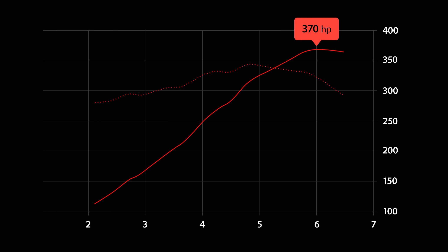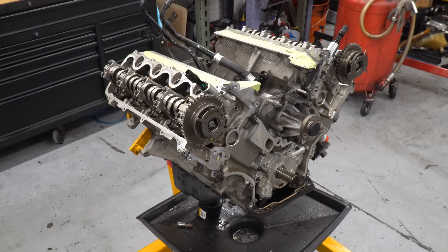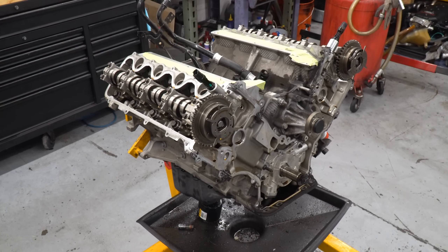So how long did it take, and how much power is the Mustang making? It took my shop roughly three weeks to rebuild the engine, and currently the Mustang is only putting down a paltry 370 wheel horsepower, which is 30 less than I was hoping for at a minimum. I think the lackluster performance is because the cams I have now aren't optimized for a stroker engine or ported heads, so I'm going to install a set of super aggressive high lift cams and see where that gets us. If you're interested in seeing how this plays out, you know what to do — hope you come back for the next one. Peace.